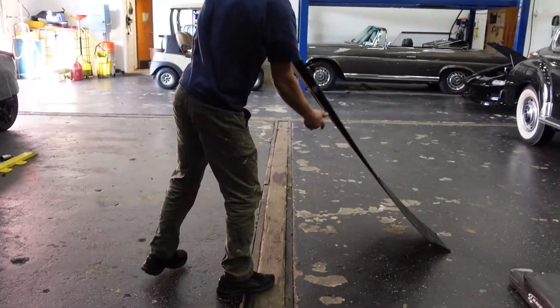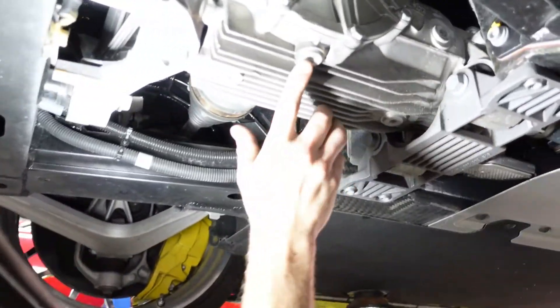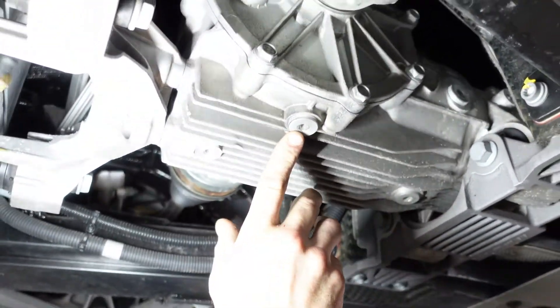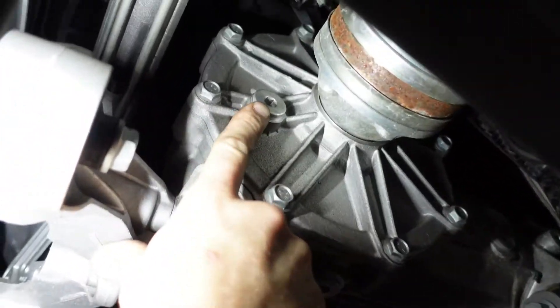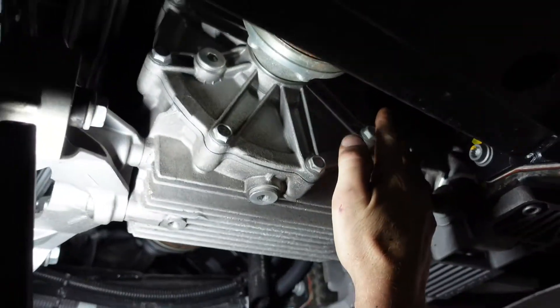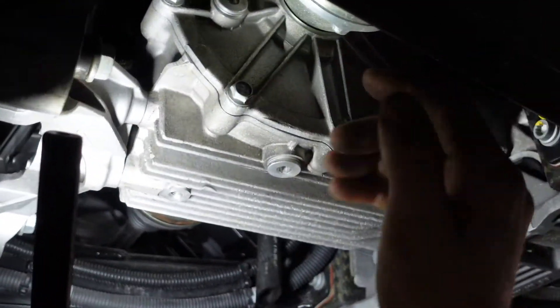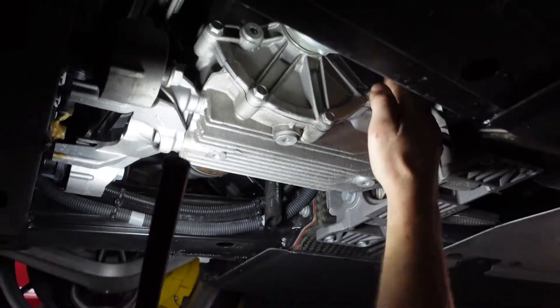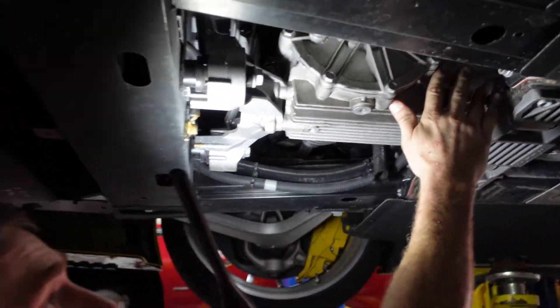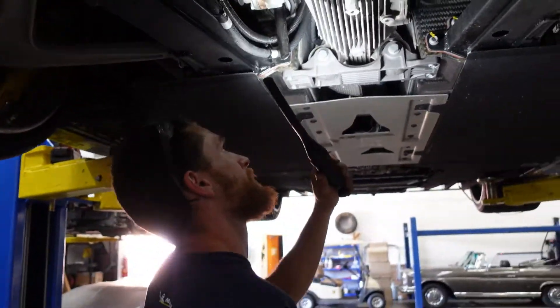And that's the powertrain of an Aventador. On the front differential, we have the drain plug. Over here we have two fillers — one and two. We have both out when we're pumping the fluid in. Make sure we have the fluid coming out in a regular flow from these plugs when we fill it up, which we'll show you guys as well. Then we'll be good to go to put the new plugs with new washers in.